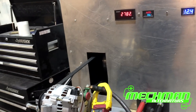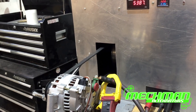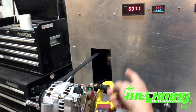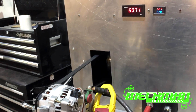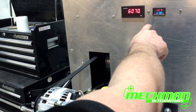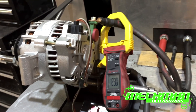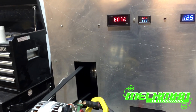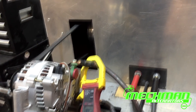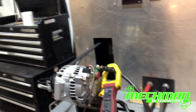We'll apply a little bit more load and spin it up to 6,000 RPM, which is about cruising speed on one of those trucks. So we've got about 6,000 RPM — we're at about 12.7 volts with a 150 amp load against it. We're maxing out the alternator; it's only making about 118 or 123 amps depending on which meter you're looking at, and the voltage is down at battery voltage — it's basically maxed out. So we're going to pull this off and try one of our new 320 amp large case hairpin units and show you the difference.